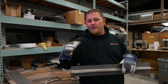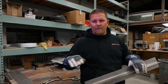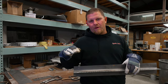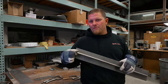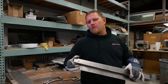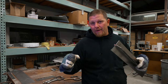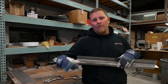We do have a MIG welding video that goes into great detail where we talk about everything someone who's never welded is going to do and critique each little thing. Once you're done, I like to use a 36 grit roll lock on a three-inch die grinder to face the bulk of the weld down, then change to an 80 grit to finesse it out. We don't want to make the new metal thin in an area that's going to crack. To know if it's a good weld, you want the two pieces to actually tear around the MIG plug weld — not break apart. If it breaks apart, your weld is too cold.